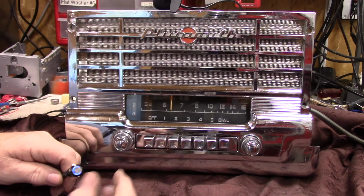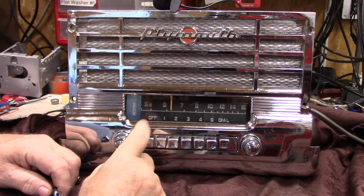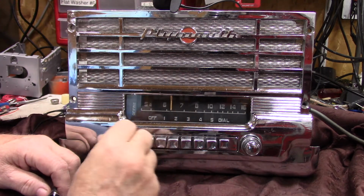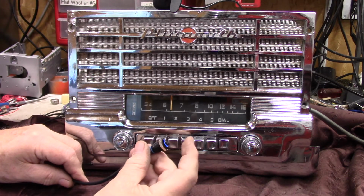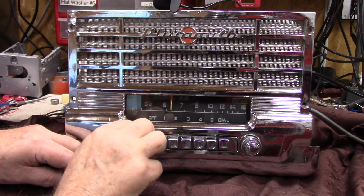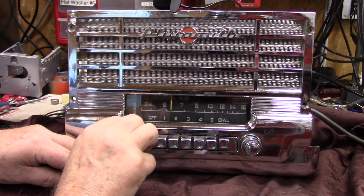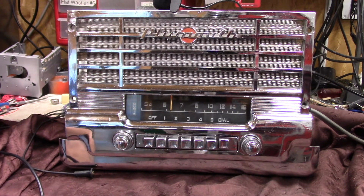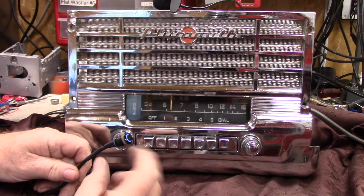Now if you put in a lot of speakers, because you got 2 channels here, 2 more channels and a sub. You have a built-in loudness, built-in EQ, crossover right here, balance and fader. Fader you might want if you put more speakers in, to bring the back ones up, let this one down. So I'm going to show you how to get into that, and that's where this comes in handy. All you do is press it once and hold it down. Fader adjust. Go to your toner. There's this speaker. There's the rears. Now that little popping should tell you that you bounce. Fader set. Balance, you shouldn't have to worry about because you have stereo right here side by side. But it's 2 clicks and hold down, that's balance.